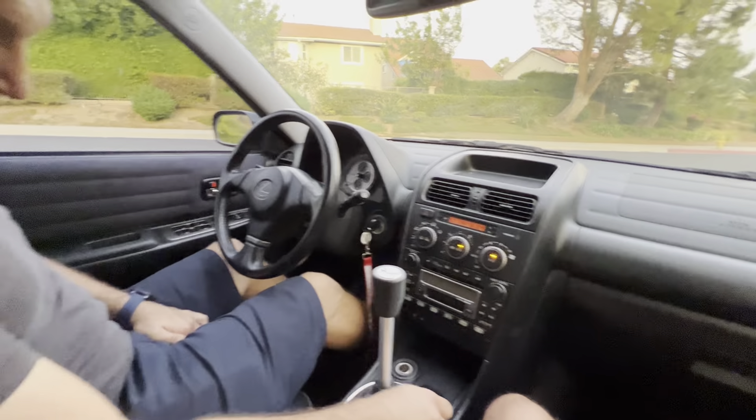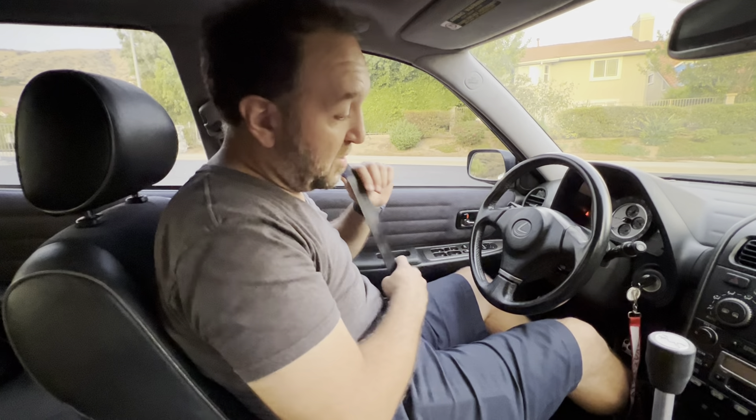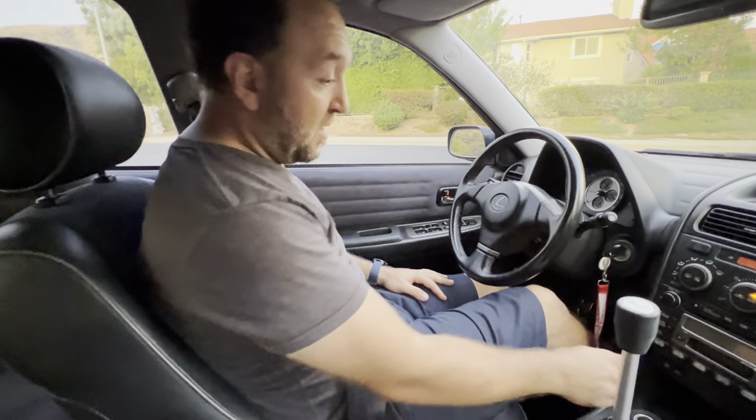Let's make sure the AC is on and working. I hear that rumble — yeah, because the PMC has a solid flywheel, you will hear the gears rattling in the transmission. Press on the clutch and it goes away, so that's the cause of that rattle.